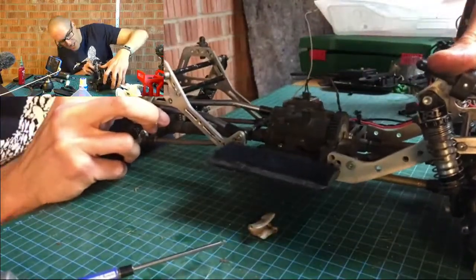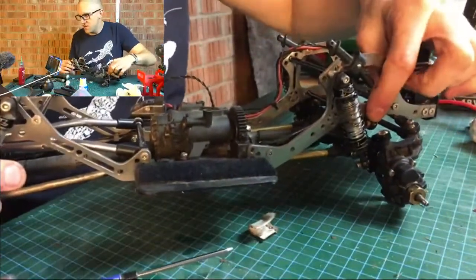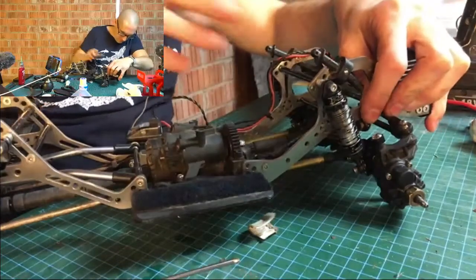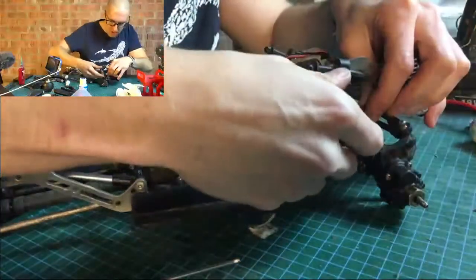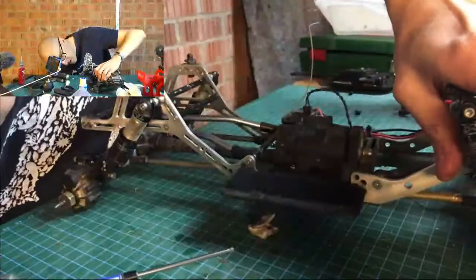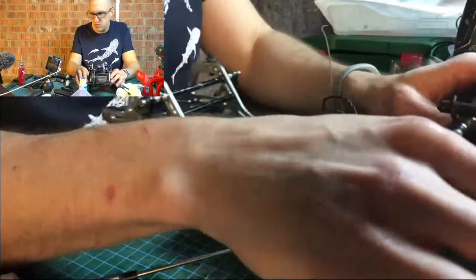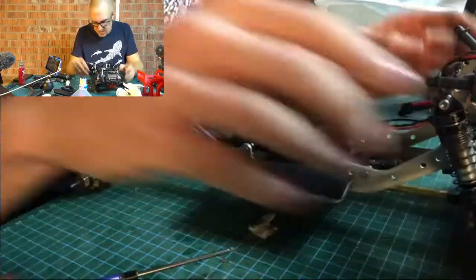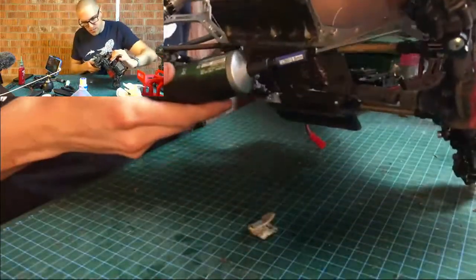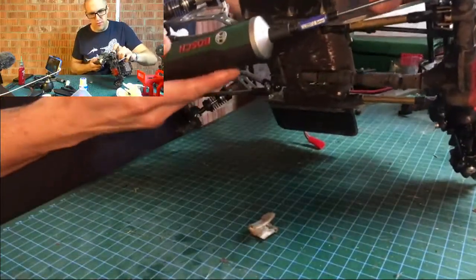that now actually needs to go on to the next one, because what's happening is we're hitting my panhard bar and the shock is not quite on the bump stop. It's also hitting my steering link as well, which is why the truck's been wiggling. So we actually need to raise this front suspension ever so slightly. I do like to try and have all the travel if it's available.